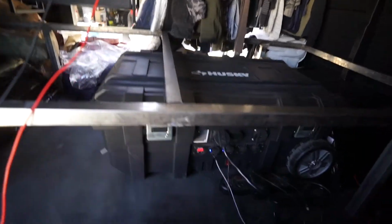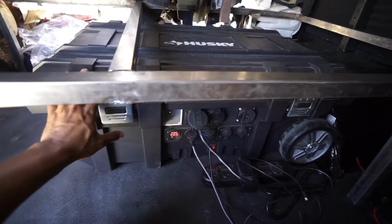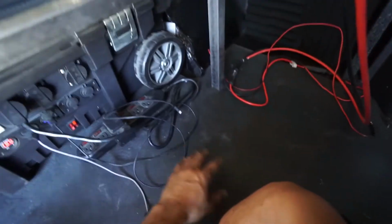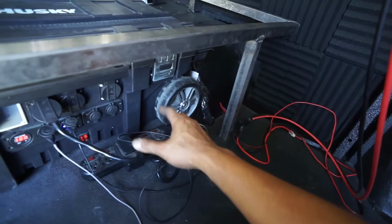Alright, so I got my battery box in there, where it's going to sit for the most part. I think ideally I'd want the battery box to be on this side of the van to help distribute the weight, because the fuel tank is right under here. So most of the weight is on this side, but utility wise I found that having this space to use is way more useful, just functionally, because if this is over here, I do have a kitchen unit that's going to go in right here, right next to the fridge. And so when the kitchen unit goes in, this space kind of dies. It's kind of a dead space, so I can't really get to it that easily when I have a kitchen. And so that's why I'm putting the battery on this side, even though the fuel tank's also on this side.